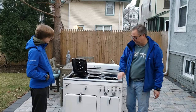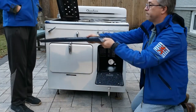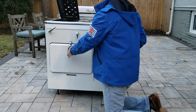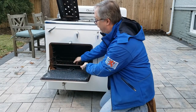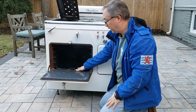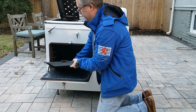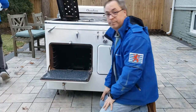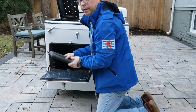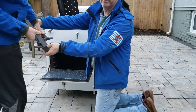Now we want to take care of the pantry and the oven. For the pantry, take out the shelf just so it doesn't rattle around. In the oven, take out the rack and the bottom oven floor baffle — remember, lift it up a couple inches, pull it out, slide it out, and hand it to your assistant. This just saved you a lot of weight. Then take off your oven burner as well — it's another heavy item you don't have to deal with while moving the stove.